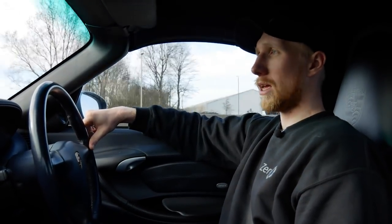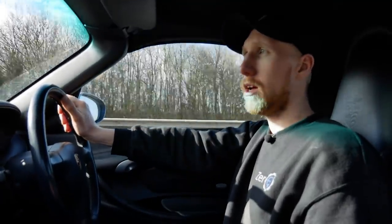I'm currently doing 264 watt-hours per mile, which is not bad for a converted vehicle, and I've used 3.8 kilowatt-hours since I started driving. We've got a 3.3 kilowatt AC charger fitted as well as CCS — we reached the point where we didn't see the need for a large AC charger when you've got the option of CCS fast charging. Most people will just charge at home overnight and rapid charge on the odd occasion when doing a long journey.